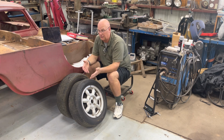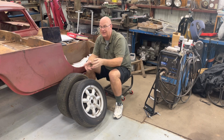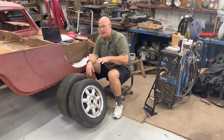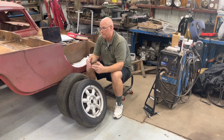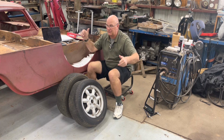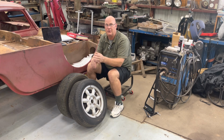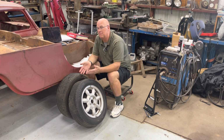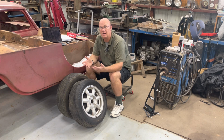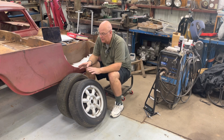What works for me, because I have four-wheel independent suspension on the Porsche, the Miata, and the Mini, is something that I can put around the car and move the car front to back while doing my adjustments. There's a whole lot of people that just put jack stands and pull PVC pipe around their car and do it. Perfect. You saved a bunch of money. But you cannot move the vehicle when you do that and get a repeatable measurement. I try to make a sales pitch.